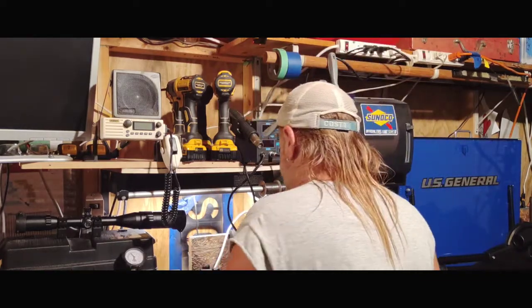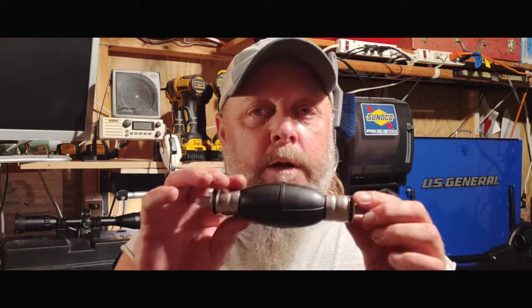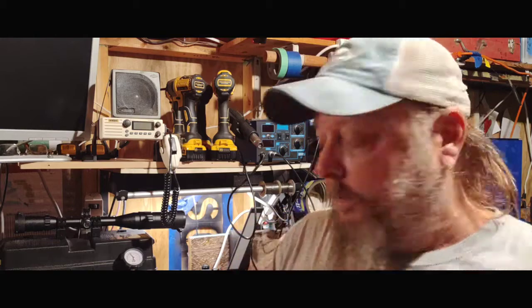They're very well made. You don't have the leak problems around the fittings where they're losing pressure and stuff like that. But as you see, they're just a really good bulb, well made. And these, like I said, are horsepower rated. This one was rated, I think, for 80 or 90 horsepower. And it has the plastic connectors on it here, where the one that's on our Johnson outboard, which has a Yamaha bulb on it, has the aluminum ends as well. And the inside of it, for the valve here that holds the fuel, is different as well. A little heavier made, where this one is not.